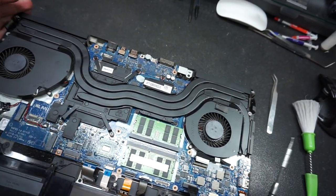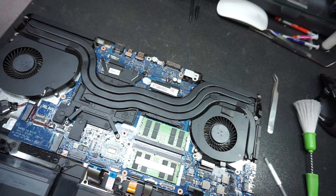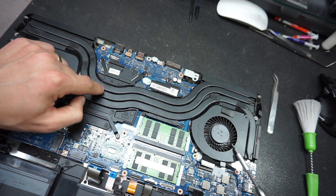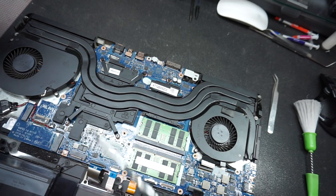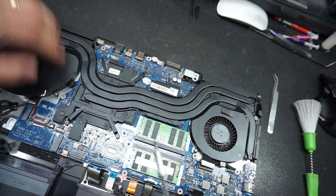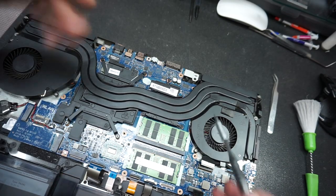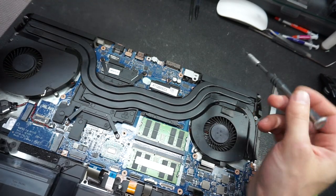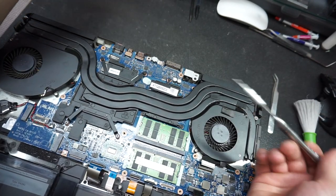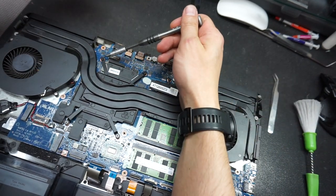What we're going to do now is remove the heat sink, remove the fans, clean them up properly, and then reapply the thermal paste and thermal pads if needed. All the screw locations have numbers next to them. You can start from anywhere during disassembly — it matters more when reassembling. I'll typically start left to right, beginning with screw number 7 on top of the graphics card.